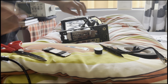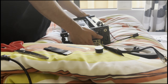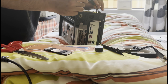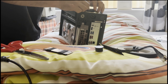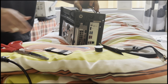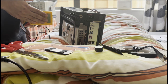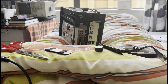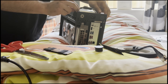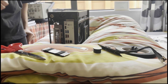Now we do the final connections. We don't need this extra two-pin, so I'll just bring that up and connect them up. Let me do a continuity check while I'm here because I won't get another chance — perfect, that's looking nice. Always do a continuity check before you wrap everything up and tell yourself you're never going to open it again. This last bit should just tuck in somewhere here, and that's all the power stuff done.